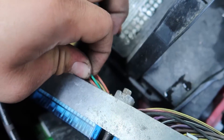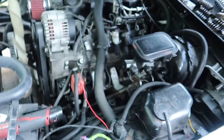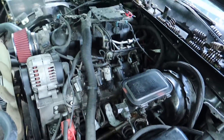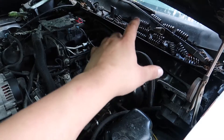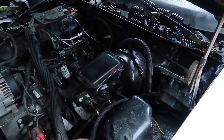I'm not sure where this wire goes in this swap — this isn't my car, it's actually a buddy's car I'm working on. I need to basically cut and run wire from pin 58 to wherever I'm going to have the OBD port, and run it to the interior of the car.